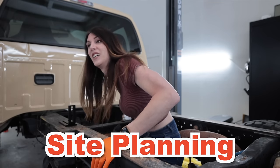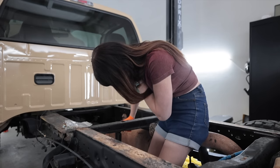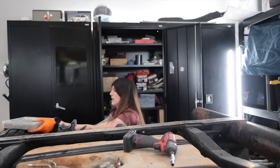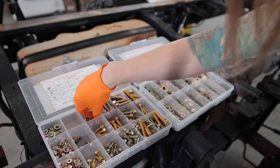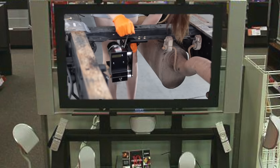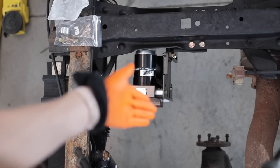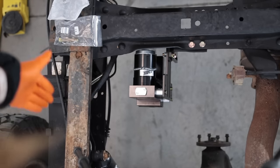Can I sit on the pumpkin? Nobody's ever said that one before. Yeah, that allows me to get two bolts in. I don't think the drive shaft will be anywhere near there — do it back here, get it further away from the drive shaft. Rapidly depleting my hardware inventory. Got a rubber isolator. That's out of the way of the drive shaft. Pretty much the perfect spot. It's not impeding the driveline whatsoever. It's firmly mounted with two bolts instead of one, and it's in an area where it's not going to get hit off-road based on where the tires are in relation to it.